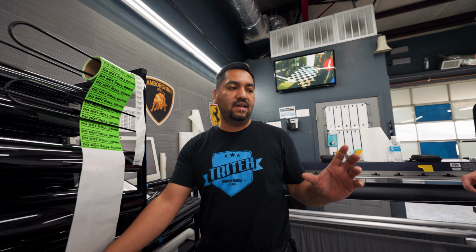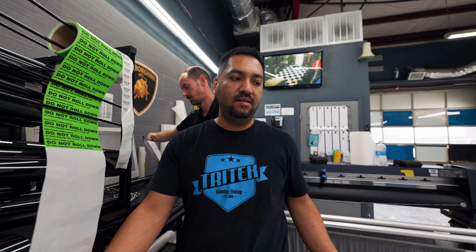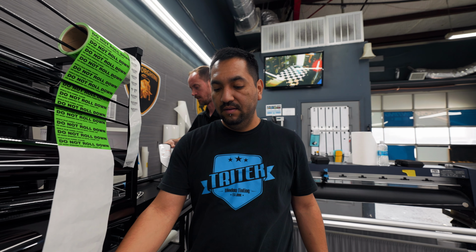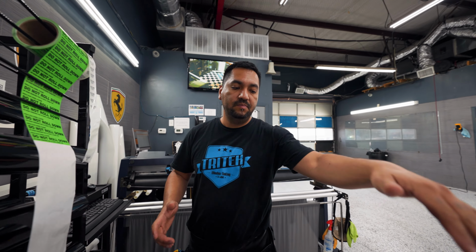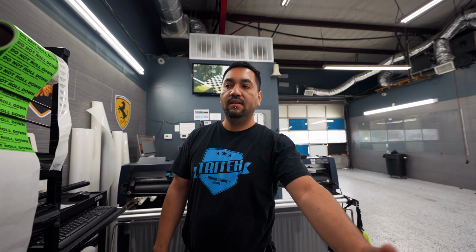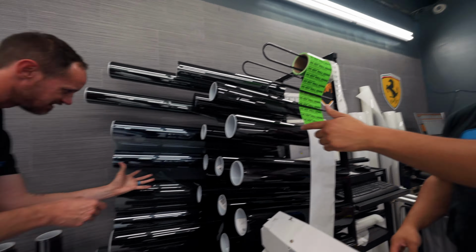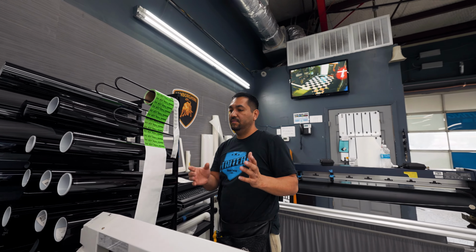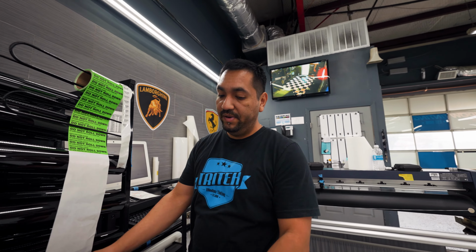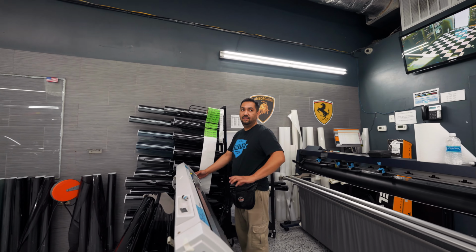See, the rear glass has privacy glass. It's just black glass. You could say dark glass. It doesn't protect anything. And so he's gonna go over there and measure what would be the difference between the 15% on the frontal windows that is clear and match the back with some lighter film, so it's about the same in color, but it's still gonna protect better than just privacy glass. So it's still gonna have all that quality.